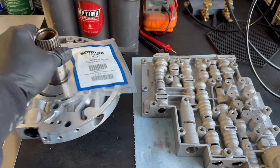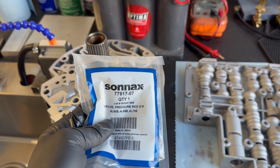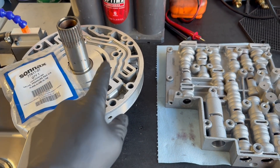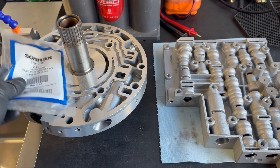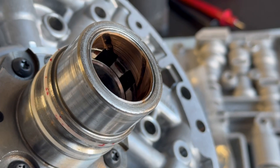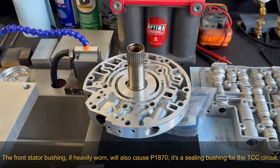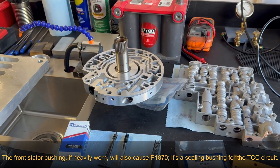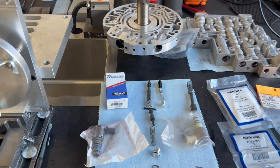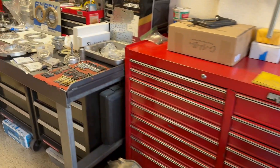For our pump, there is an oversized pressure regulator valve that comes in the HP1 kit, part number 77917-07. They did not ream the casting and install that valve — the factory valve was in there and it was pulling something like 12 inches of vacuum, so we'll correct that. They also didn't replace either of the bushings. Look how worn these bushings are — this bushing in the rear of the stator shaft in particular will cause trouble code P1870 or P0894 in later units if it's worn out enough, and no amount of valve body repair or replacement will get that code to go away. It'll just keep coming back until you address the bushing situation.